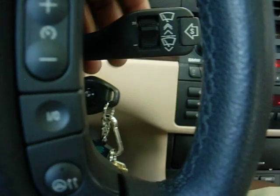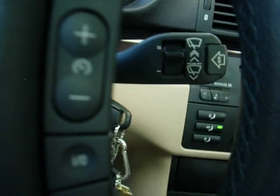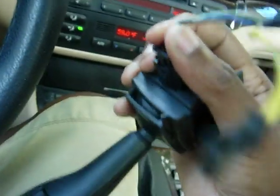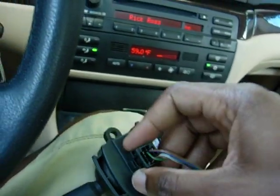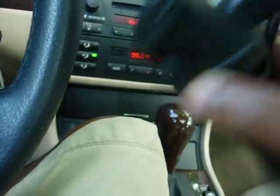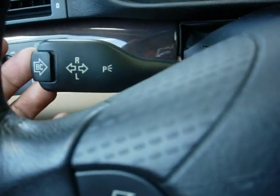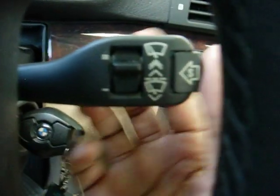When you put this in your car, you have to make sure pin 10 on this thing is wired, because the S-function stalk comes with its own harness. Pin 10 has its own wire coming out of it — a black and gray wire — and that's really all you need. The function is inside the body of the stalk, so your car should be pretty much wired to accept it, just like when you add an OBC stalk to a car that doesn't have the BC button. You just have to add the stalk.